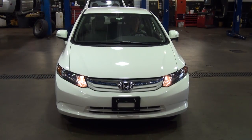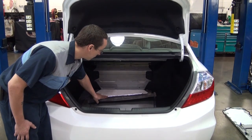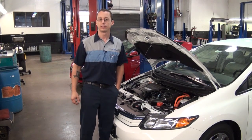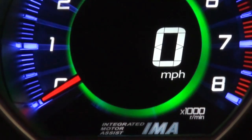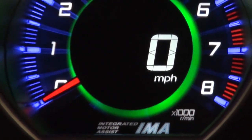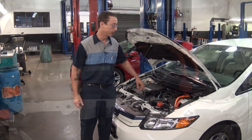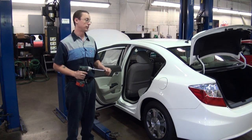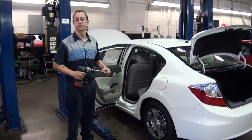If you're still not sure whether or not the vehicle is a hybrid, simply pulling back on the trunk lining can reveal the battery IPU module's back plate. All Civic hybrids and the Accord hybrid have high voltage AC compressors that can run when the vehicle is in auto stop mode. These voltage wires have the same current capacity as the IMA motor wires and battery wires, and can also be located and identified by the bright orange coloring around the wires.